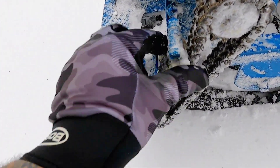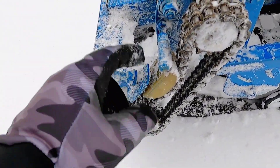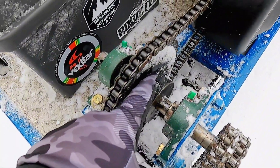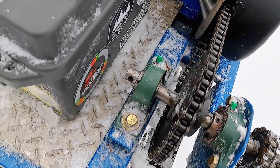The gearing I used from the original sled — it's a double chain. I did have to purchase a double chain master link to shorten it up. I used the stock tensioner and built the bracket out of some angle iron using the stock bolt, all mounted there. The bearings are pillow block bearings in different styles — I purchased all of them and they're in the links. The sprocket and adapter — I think that's a 37-tooth, might be 38, I'll put that in the description.